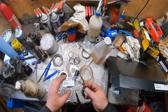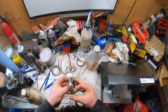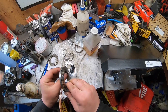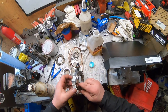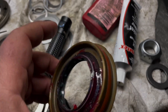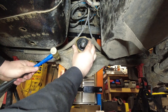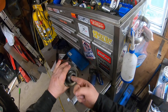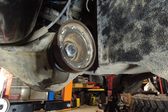Now it's time to take the seals and install them into the air locker piece. I do want to point out that the shims in the video for the carrier — I ended up using the old shims, but I need to shim it another 30 thou more, so that kind of actually worked out pretty good. Now I've got the seals installed — lubricate them with some oil and push them on the air locker. I know I've got my pinion preload set up, so I can install the seal. I put some extra grease on it to help keep that spring in place when you go and tap it in. You've got to take it all apart again — use a brand new nut with red Loctite on it. Then with a brass hammer, tap that seal into place. Once that's done, I've got some silicone on the splines of the pinion coupler, and that's going to ensure there are no oil leaks coming out through the pinion nut.